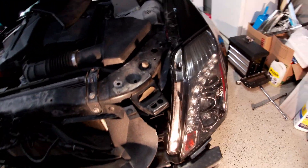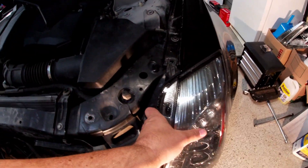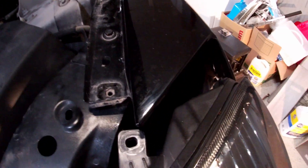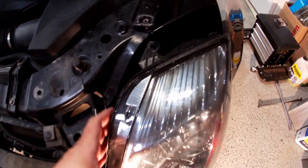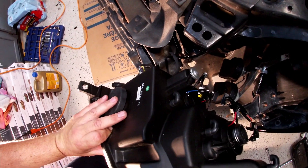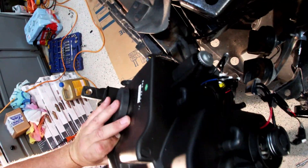With those bolts removed, it's just a matter of taking this lens assembly and wiggling it a little bit. It does tuck up under the fender, so it's a bit difficult to get out easily. Push it down — you can see it sits on this little piece here — and then it lifts right out. There is your access to the bulbs on the back. I've got aftermarket assemblies and I'm using LED bulbs, so that's what you see down here.